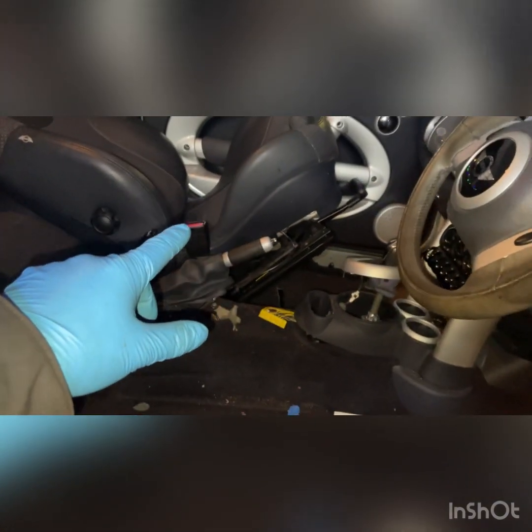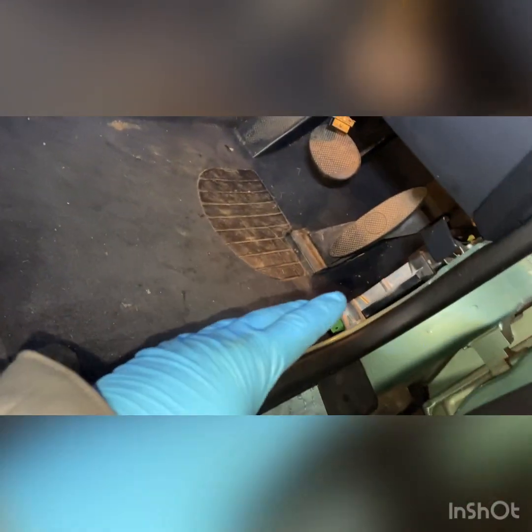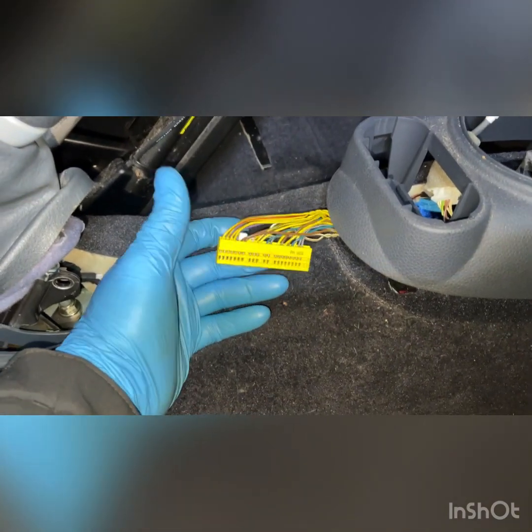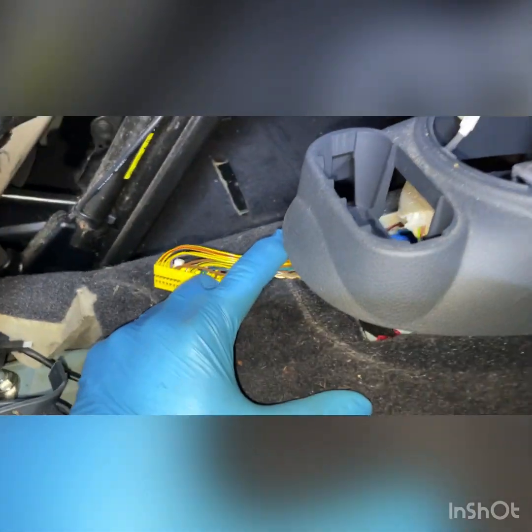So looking in the car, what I've had to do is move the seat on this side, had to do the same with the seat on that side, had to move the trim that goes in the centre, lift this trim up, pull the carpet as well, so remove the trims that run down the side here of the car, and again, rear seat belts. So did that on both sides, I've lifted all this up. Disconnected the airbag control unit, so I took the battery off, disconnected the airbag control units underneath here, and as you can see, I've fed the wiring back up through the carpet.